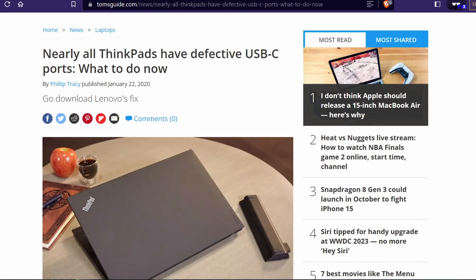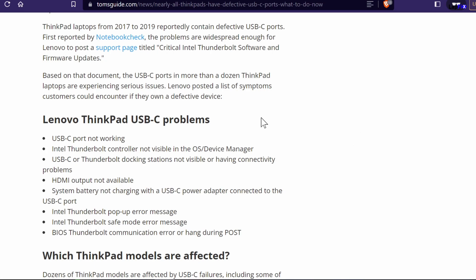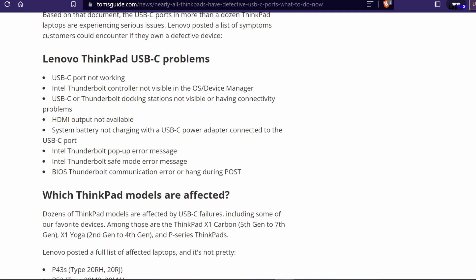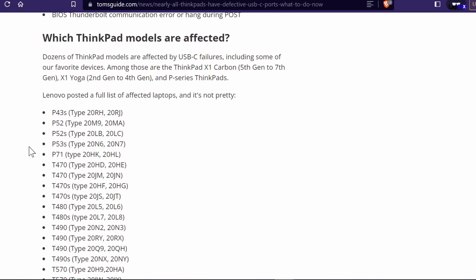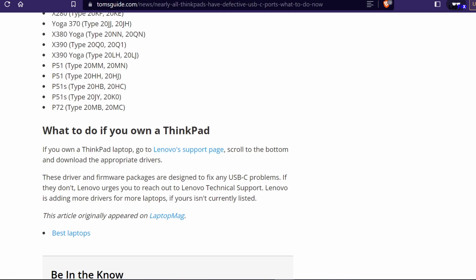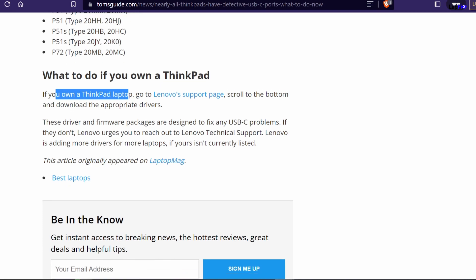This article has been out for some time, but it's always important to show because it specifically covers USB-C issues with Lenovo ThinkPads. The first issue listed is the USB-C port not working. These models have a Thunderbolt controller — there are HDMI out and power/data issues. Our P53S is actually listed here as one of the impacted models, along with the X1 Carbons and Yogas, which are very popular. It shows you can go to the support page and try drivers, but in this instance the drivers aren't going to help because it's not working at all.